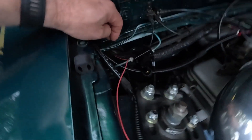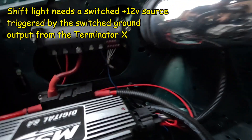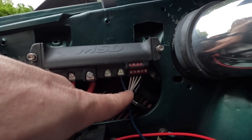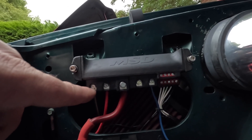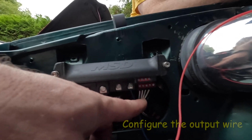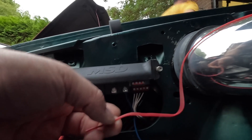We're losing light here in England but the wire's through the firewall and we're going to tap it into this harness. We'll bring it down and over where the ignition is, then up to where John has the solid-state MSD relay. We already have four outputs from the Terminator going into it — outputs one, two, three control each of his fans, and one controls the electric water pump. Output four is just sitting there waiting for this wire. We'll change an input in the computer — whatever rev limiter RPM we want — set tied to this output at 8500, sending switched 12 volts out to the shift light.